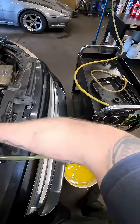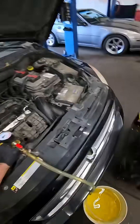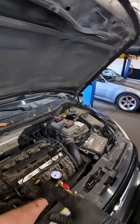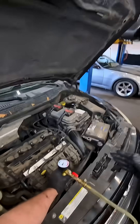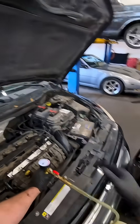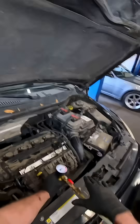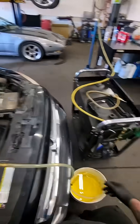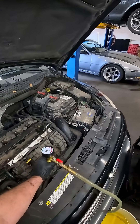This is the most efficient way that I've found to fill up a cooling system. Of course we'll still go drive this afterwards to make sure the coolant is circulating properly and make sure it doesn't airlock or have any issues. But out of hundreds of cooling systems that I've filled using the vacuum technique, I can't think of any where I've had air trapped in the system.